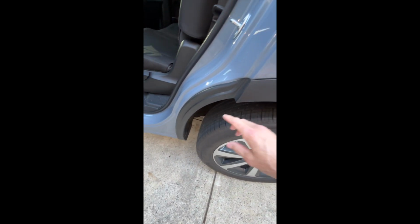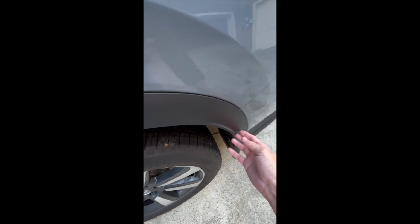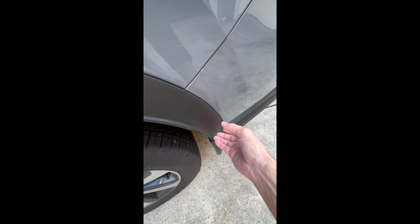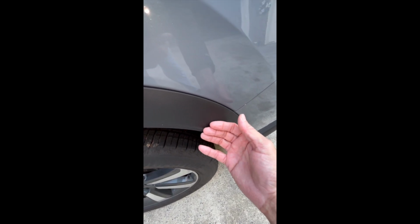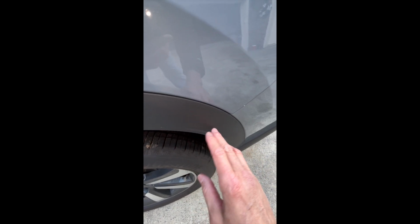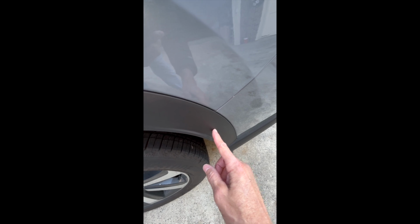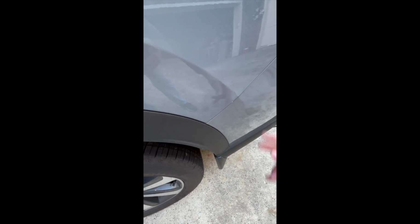All right, with all those screws out, you can start to take this off. All you'll do is start at one end and start to pull out, and you'll feel it starting to pop. Work your way up through this thing, and you're gonna pull this all the way out. Be careful down here. There's a little tab that dips down in, so you're sort of pulling up and out at the same point in time, and that'll remove this black trim. Once you get this removed, you're gonna see 2 bolts, a bolt and a tab that you'll have to remove from right here.